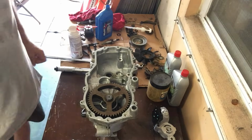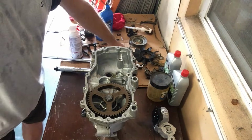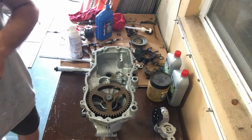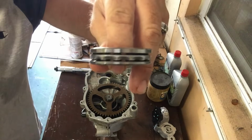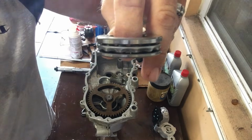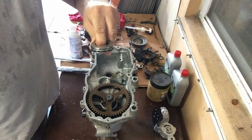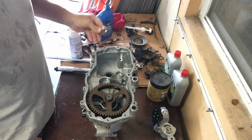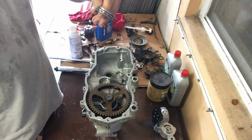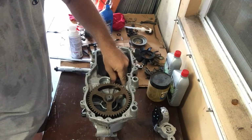So, all right, about 8 to 9 hours into this project, prior to the reassemble. So we're going to get into this. So we have a bearing thrust here, and you can see that actually one of these plates is thicker than the other, and you'll see that in the service manual as well. It will highlight that. As long as you labeled what you took out in what step, it shouldn't be an issue, but the thicker end goes up to the top.